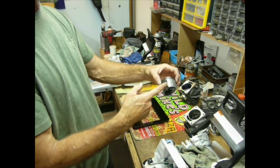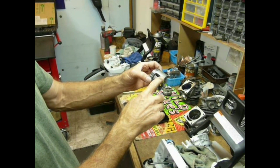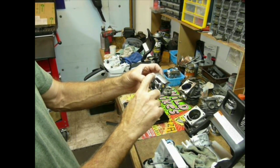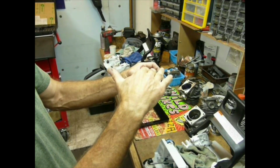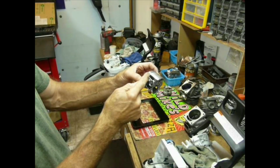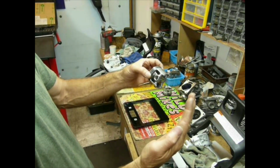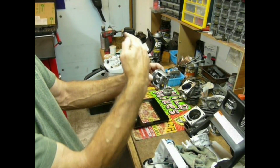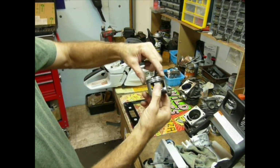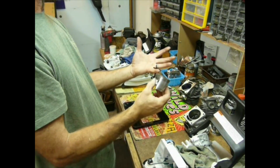I did do some miking on these, and I found that this piston is round, and it only tapers from, we've talked about how they're kind of barrel shaped. They're a little bit more narrow, a little bit wider, bigger in diameter, and then they kind of get smaller as they go. A lot of times they'll stay relatively consistent till about right here. There's no rhyme or reason, but they call them barrel shaped. They're not actually like this. They're kind of like this. But it's the same diameter any way you measure across the dome. So this one really doesn't have any ovality to it, I guess.